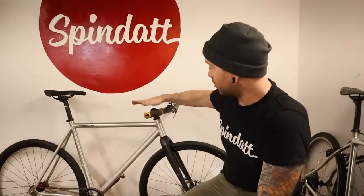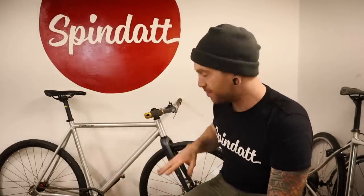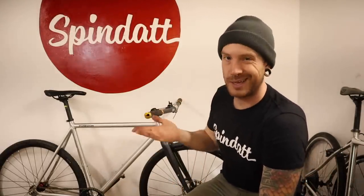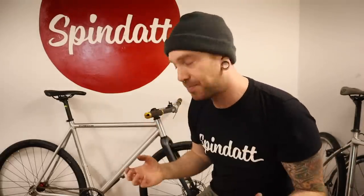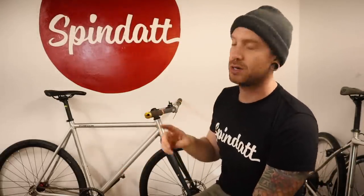Tracklocross build complete. We are now back to two silver bikes contending for your heart's desire. I'm gonna go ahead and say that the Tracklocross will always be leading purely based on nostalgia. That could change. I currently do have a very stubborn yet promising tubeless setup on this thing right now. Problem being the tires are not tubeless ready, so of course they want some time to allow for the sealant to build up around the bead so that air stops seeping out. But by tomorrow, I see that being a non-issue.